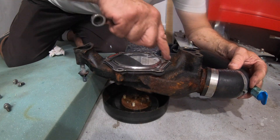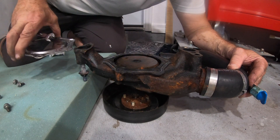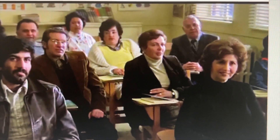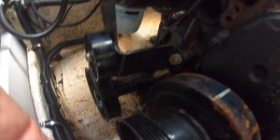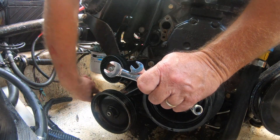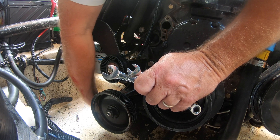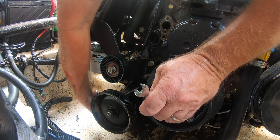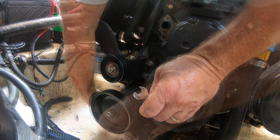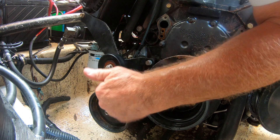It turned out that the thing I could not reach was where I needed to be — that was the water pump on the bottom left. You can see that I'm already bleeding, and I was trying unsuccessfully to get the 10mm bolts off the water pump housing. The easiest way is just to remove the whole thing and then do it on a desktop or benchtop. Once I removed the idler pulley and the frame that holds it, everything was easy to get to.